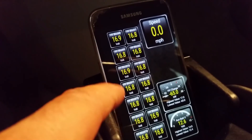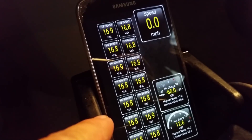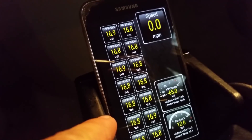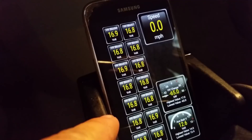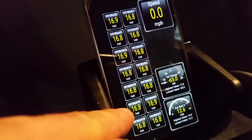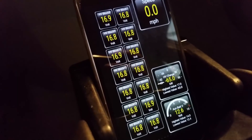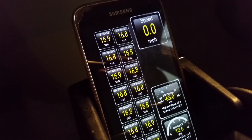If any of these are within one and a half volts lower than the rest of them, that's what triggers it — hey, we've got too much of a variance here — and it throws a check engine light and shuts this thing down. That's when your car goes into limp mode. So you need all these voltages to be very close to one another, and just driving the car will actually even itself out on its own.